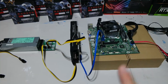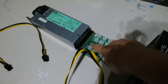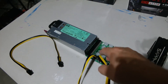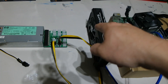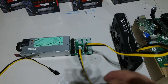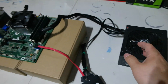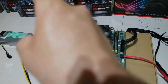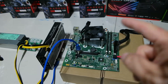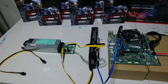A tip for powering on: there's a white power button right here on the server PSU — just press it, you'll hear a click, and it turns on, providing power to the card and the riser. Always turn the server PSU on about 10 seconds before you turn on the ATX power supply and boot the rest of the rig. You always want the riser and GPU to be fully powered and showing up before the motherboard boots.